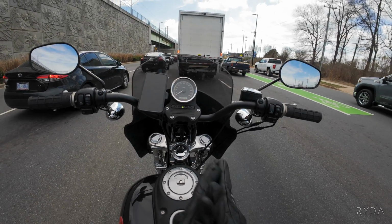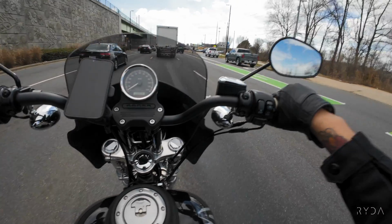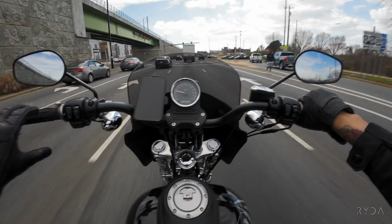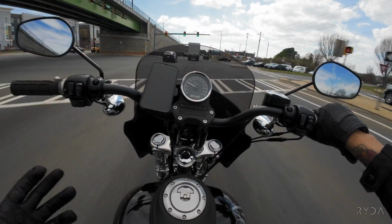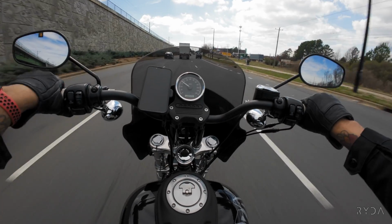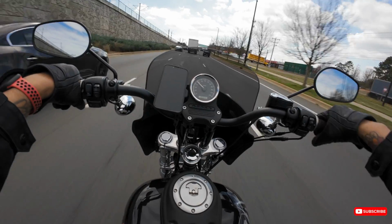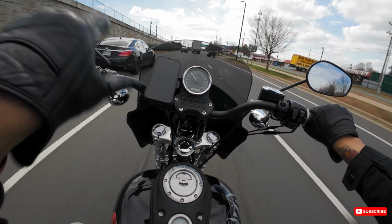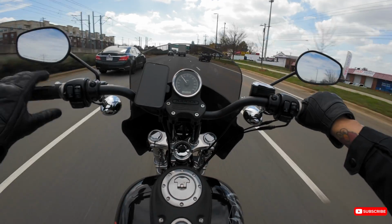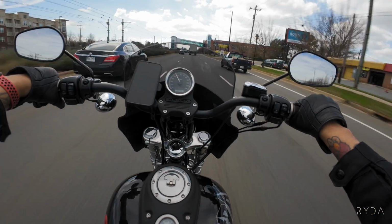The only thing that strayed me away from that is with this exhaust system, I didn't really want springs holding my muffler to the head pipes, because I noticed that on some other bikes, when there's springs, they're not clamped on tight, and sometimes you get exhaust blowing back out of where they connect. You'll see little dirt, and it gets dirty from time to time from exhaust spraying back out of there, or gas or fuel or whatever. I don't know what it is, condensation coming back out, and I didn't want that. And I don't really like the look of springs.